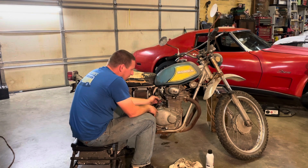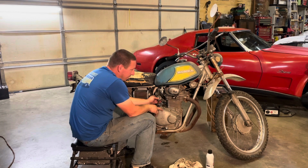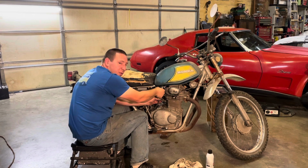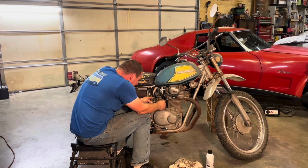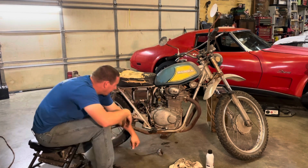If this bike would run and doesn't need any internal work, this would be an ideal candidate for kind of a patina bike, or just one with, you know, re-chroming the chrome and redoing what needs to be redone, getting it rideable, and tires are crap. But if it doesn't start and it does have a problem, then there's probably other bikes I have that would be more effective, you know, project bikes. And it's dry. So we clearly have a problem with how much float drop we got.